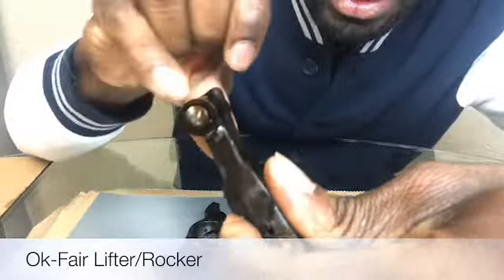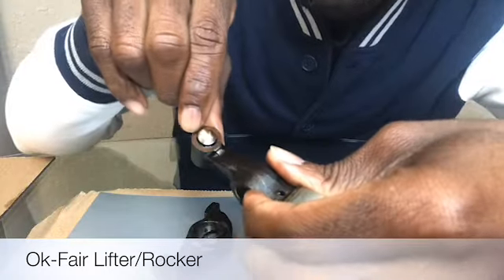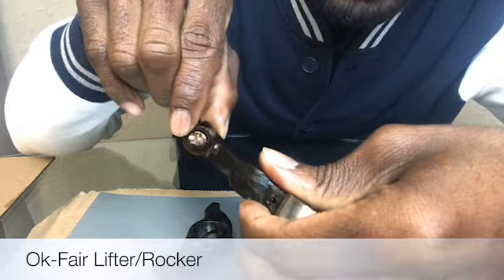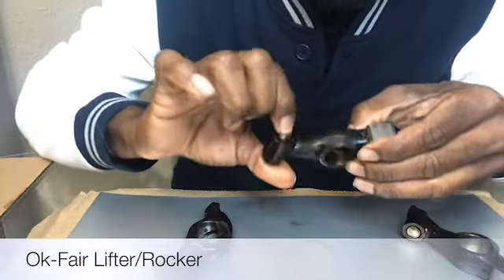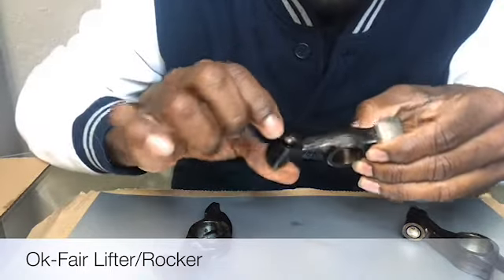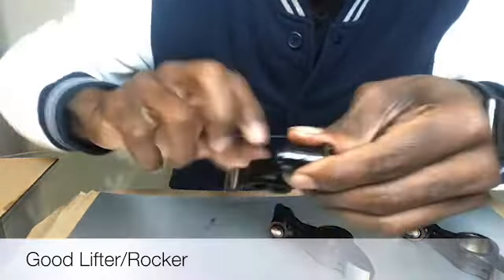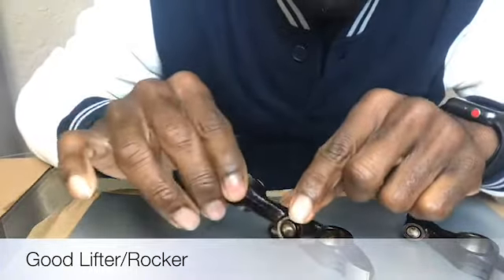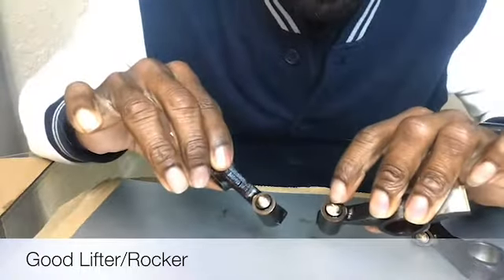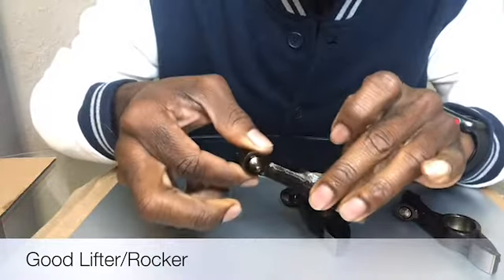You can see that imprint right there — that's because it's been working hard but not working properly. That's why it's all shiny and out of shape and actually has a wear mark on it. You have to take into account this car has over 200,000 miles on it. That's your problem right there — it won't work efficiently because it's sticking. If it's sticking and hard to push, it's no good. You could get away with it, but not for long. Now this one here is actually a good lifter.